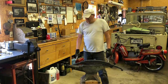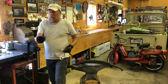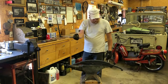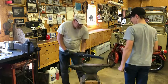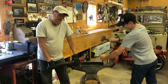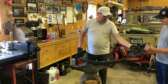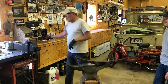We're back at the shop. Today we're going to take the spring shims out of there. We already took one of them out — this is a little shim that's in there. Since we've got new ones, we're going to put them in the leaf spring. I'm going to put my eye protection on. We're going to use the anvil. Knock yourself out — I'm sure this one's coming out easy. Just that easy. We'll get the other ones and put them back in. We can either use this tool here, stick them in the vise, or use an arbor press — but that's too easy.